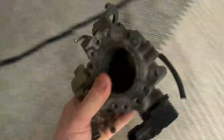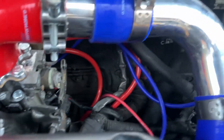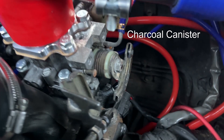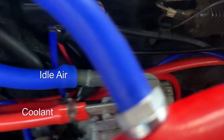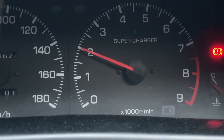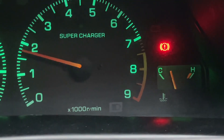Your 90-degree elbow inlet pipework is still not going to fit on the 3S-GTE, so you can buy a little connection from ATS Racing which allows you to put a silicone hose on top. Here's a little run through of the final setup: I've got the idle air and positive crankcase ventilation hoses on the inlet side, the charcoal canister connection, and going around the back, the idle air to the valve and the coolant. When the car was cold I was getting about 2000 RPM, which is pretty high, and when it was warm, about 1700 RPM.